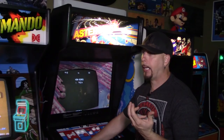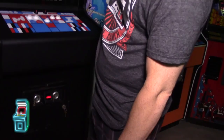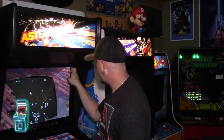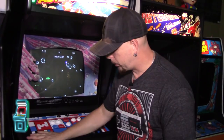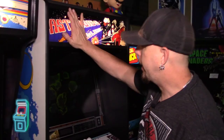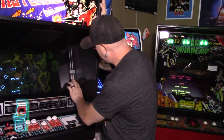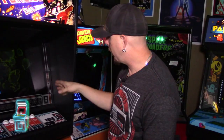My ultimate game of all time - somebody said what's the one game if you could only have one, and it seems crazy but this would be it. This is the game I had the most time with growing up. I remember seeing it in bowling alleys and begging for quarters. It's got the alley door, which is called a coin door - that's rare to have. The marquee is original, the side art is original. I did put a new plexi bezel, new cardboard bezel, and a new control panel. New buttons. We did a cap kit on the monitor and the power supply and the big blue - replaced it. Other than that this thing is really stable. On this one I did a whole new control panel overlay - I actually did a video on my channel on how I went about making that, so I'll link to the description. You can make your own.